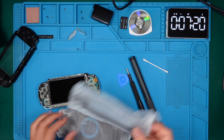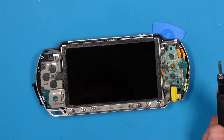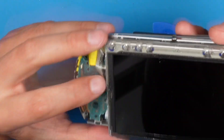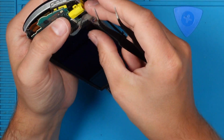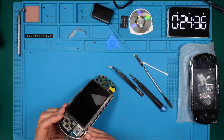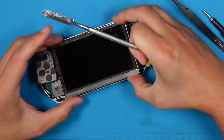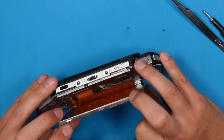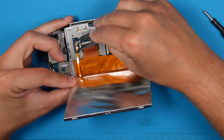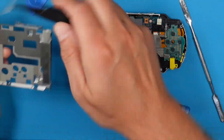Time to check out the shell in the promising box. We need to find a way to remove the screen. The button bar below the screen must be disconnected and removed by prying off both edges. Now we do the same thing with the screen itself. We need to be careful when we take off the screen — the trick is to tilt it from the top down. Next we unhook the ribbon cables and take the screen off.